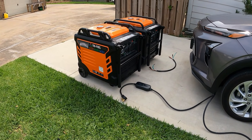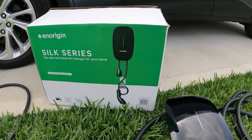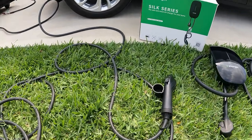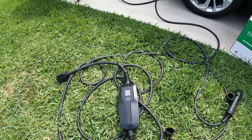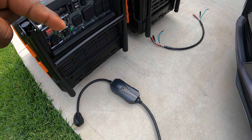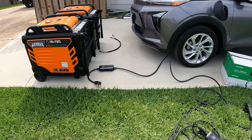Just wanted to do a quick video and do something different. We charged this electric car using an Oregon Silk Series charger — install this in your garage, 50 amp, and it will charge your car in no time at Level 2. If you want a portable one, you can get the 40 amp portable, but remember you have to have two generators — each was pulling 5,000 watts, and this thing pulls almost 9,200 watts. Or you can go with the smaller adjustable charger: 10, 16, 20, 24, and 32 amps, so you can adjust based on your generator. I could have lowered it but I wanted to show you this beast can handle full 32 amps charging an EV.